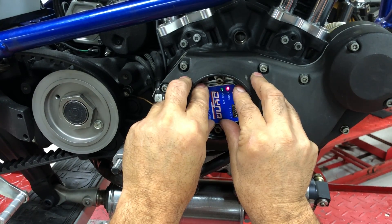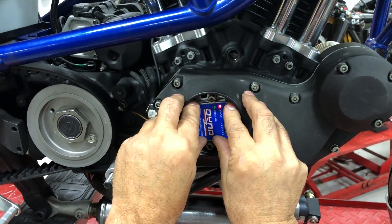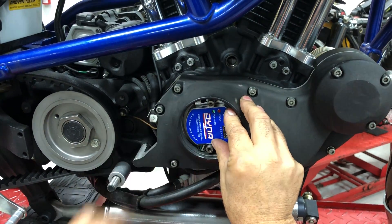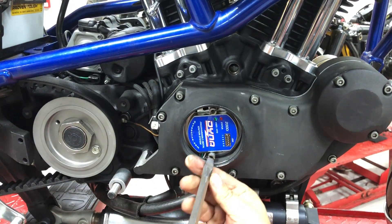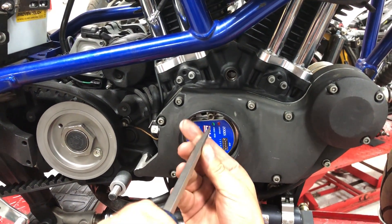Carefully follow this next instruction: find the point where the LED just turns off while rotating the base plate in a clockwise direction, then lock down the 2000i. The initial timing is now set close to optimum. Final timing may be checked and set dynamically. You can set it dynamically as well — this way works really, really well. You don't have to go out and buy a timing light. We can go ahead and set it this way and be very, very close. So basically, rotate it counterclockwise until the light comes on, then rotate it clockwise until the light goes out, and lock it down right there.